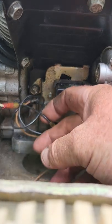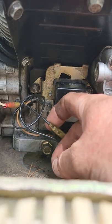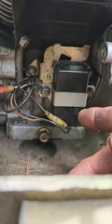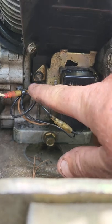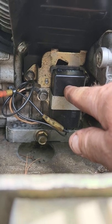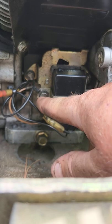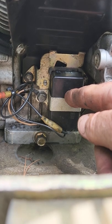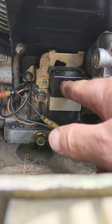The dead man switch goes into that little fitting right where my finger is. The brown wire — watch — straps right down to it. That's the brown wire that comes down and up into this unit. Now if you want to find out if your rev limiter is good or bad, you get down here, remove that bolt, relieve it from the ground, roll the engine over, and check for spark. If the spark comes back, then this is bad. It's that simple.